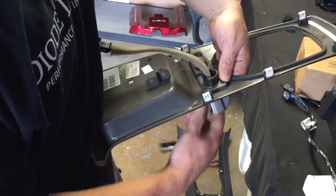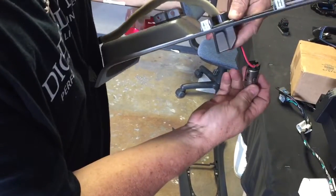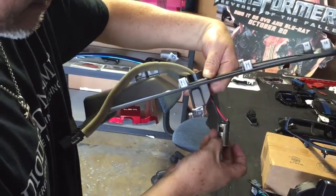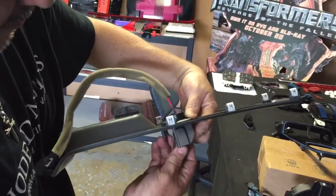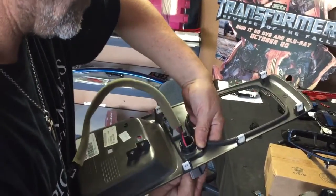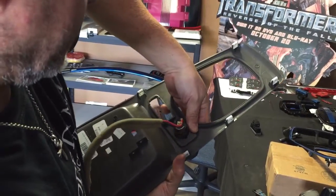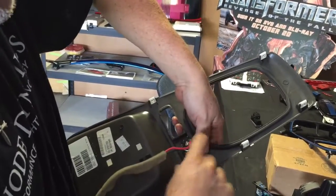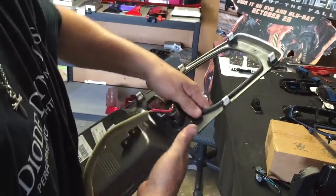To reinstall it, simply put it through again. You want it facing in the right direction with your wires at this angle, so that this little hole and that little hole will engage with those snaps. Hold it open — you can see me working it through — and it just snapped right into place. If it doesn't snap, you might just need to turn it slightly to the left or right until it snaps into place. That's it.